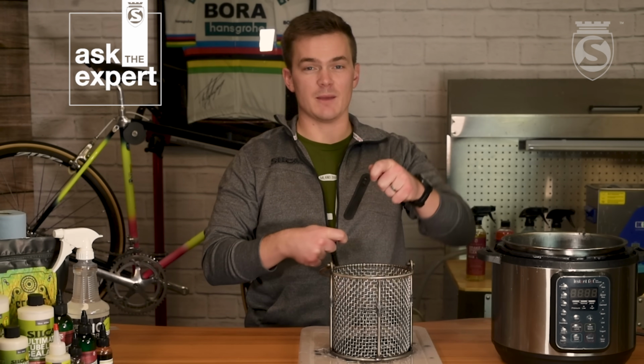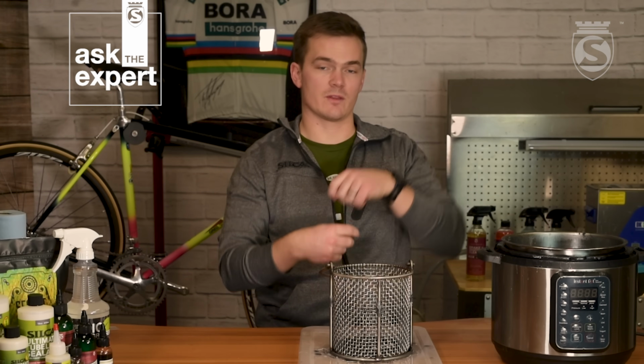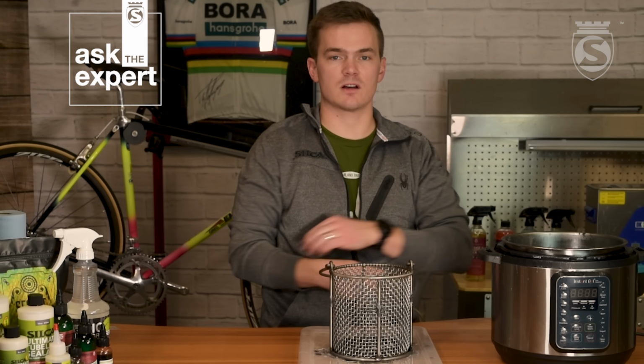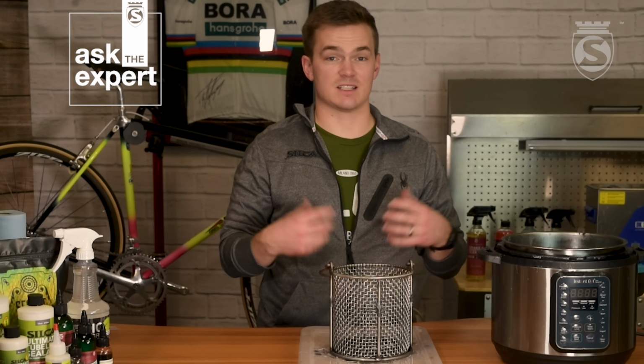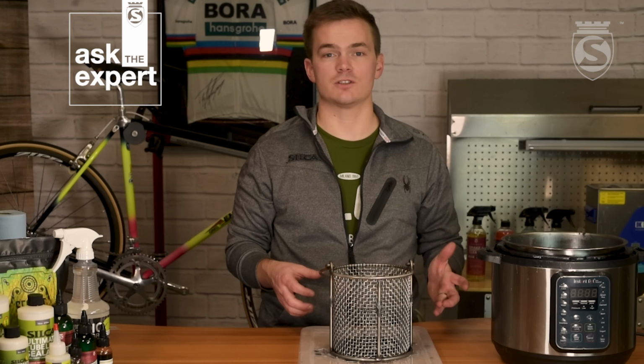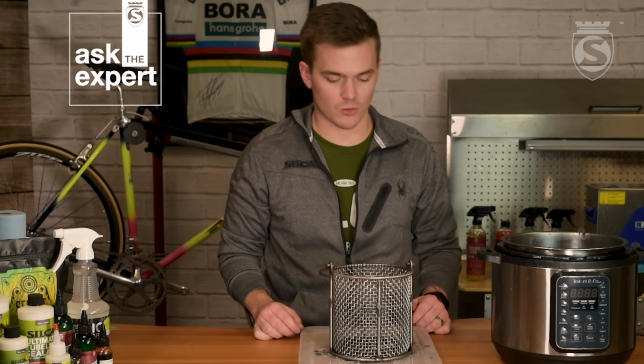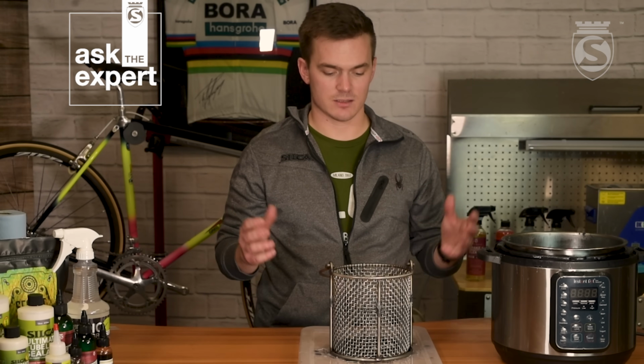You can take a pipe and run it over the pipe back and forth. That will break the excess wax off. Really the easiest way is install the chain and go ride for 2 or 3 minutes, and all that extra wax will flake right off and you'll have a really efficient chain. So no need to worry about that. We'll let this cool, and then we will have a nice 12-speed Dura-Ace chain to throw on our bike.